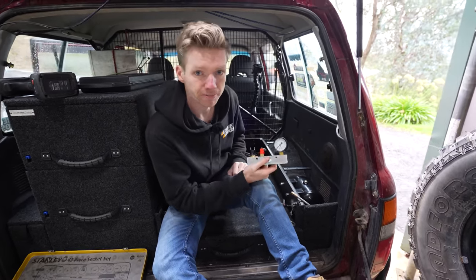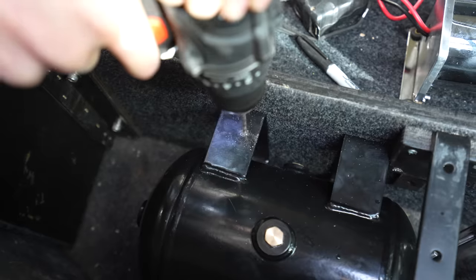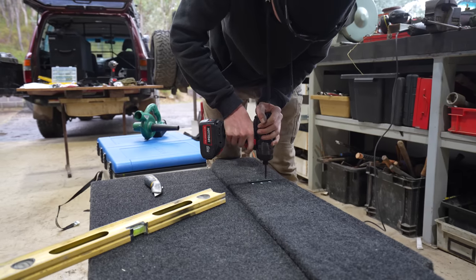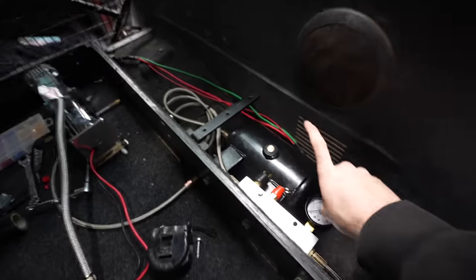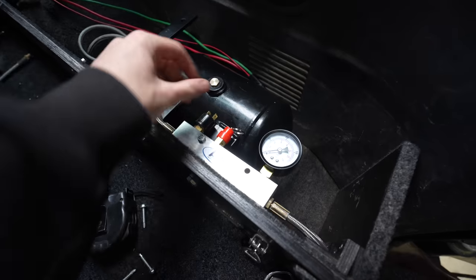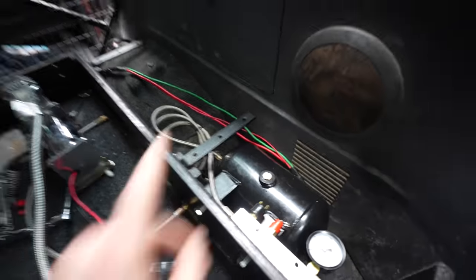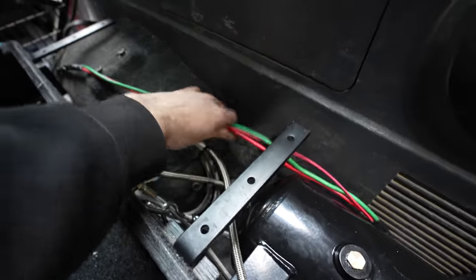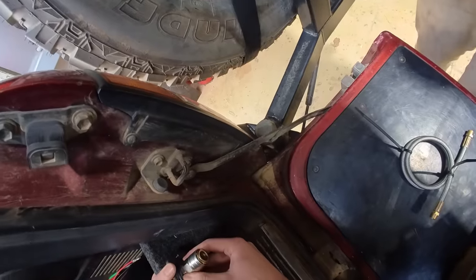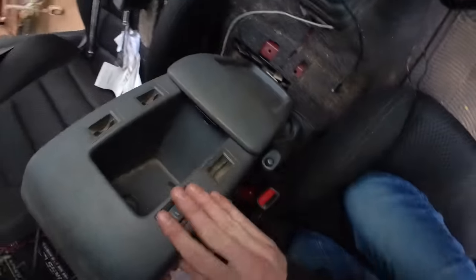This job is actually really straightforward — you can have this done in an afternoon. Once the manifold was mounted, I ran our 12-volt power, earth and switch wire from the relay, which I mounted in our 12-volt box. We then cut the wing lid in half and put a hinge on it so it can lift up to access the air tank and read the pressure on the gauge. I also ran through our electrical harness in my 12-volt box — the green one is my earth cable for the compressor. I then hooked up the compressor to the manifold, securely mounted it to the lid of the storage wing, and routed the air hose and power through the wing lid itself. We drilled a hole for the outlet hose on the front of the drawers and ran the switch wire to the centre console.